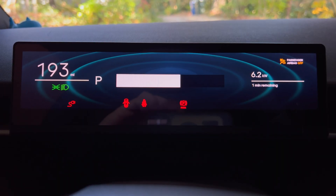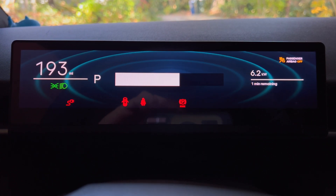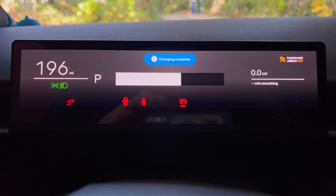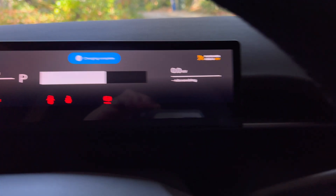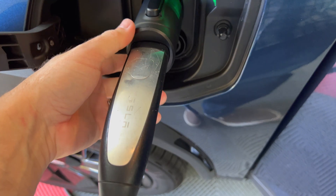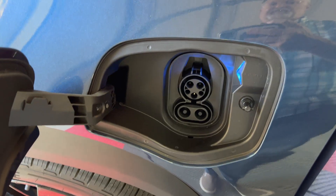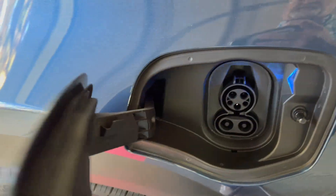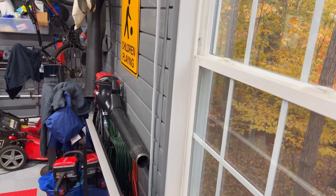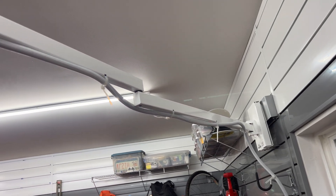That's it for the charging tests. Both adapters worked pretty well. Sometimes I had the issue where I'd have to wait a few minutes for it to start charging, other times it started right away — hopefully that will get fixed soon. In conclusion, both adapters run cool and aren't much different from the plug they're connected to. Both have high charging capacity: 60 amps for the larger adapter and 80 amps for the smaller one. However, for the Fisker Ocean the current max AC charging is limited to 32 amps, so either adapter is overkill with regard to capacity.